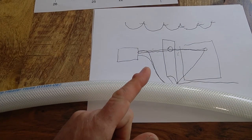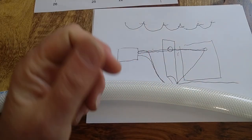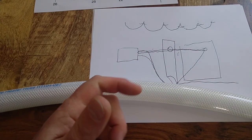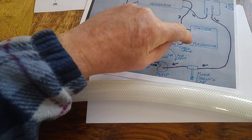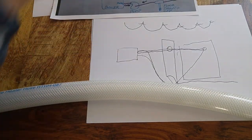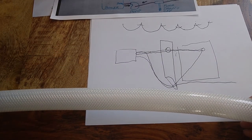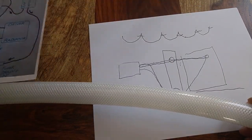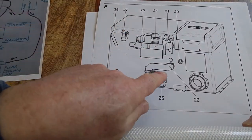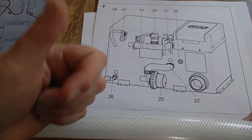So here's the plan: we're going to head out to the trailer, drain the glycol — which is really simple since I put in new drains right where they need to be. I'll drain the glycol out, drill a hole, cut the old hose, put the new clear hose in its place, move the air bleed valve to horizontal, and we're good to go. Let's get at it.